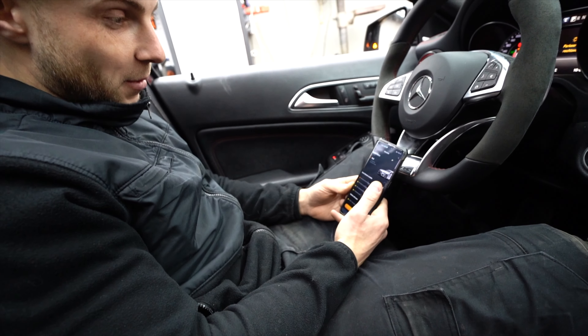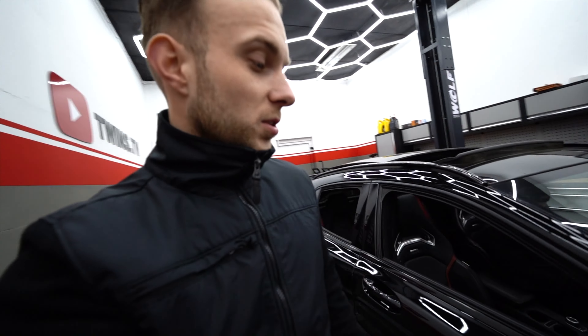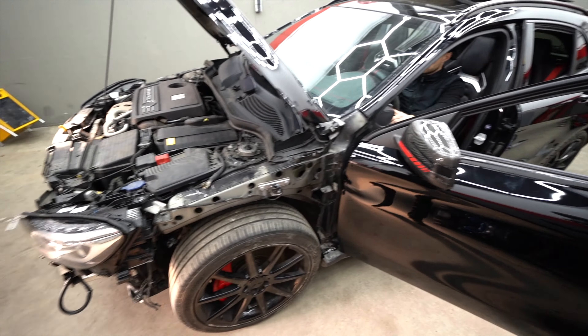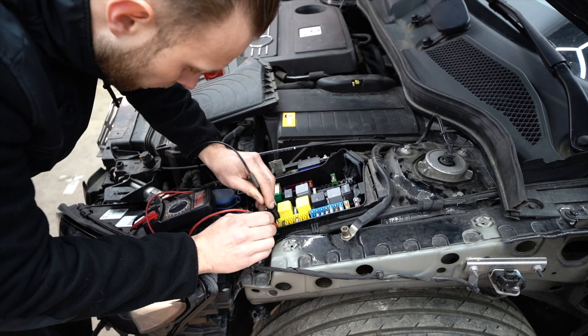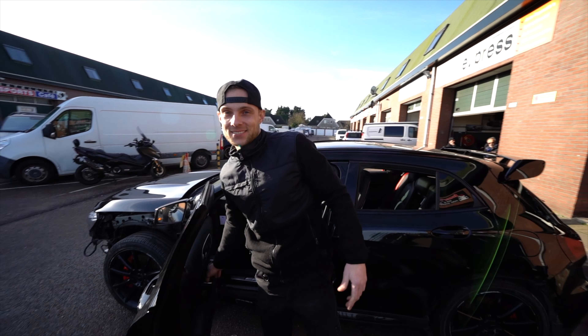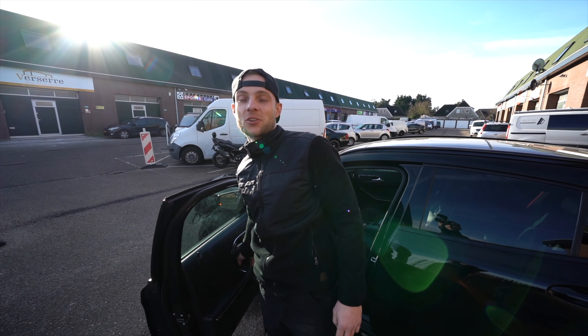After clearing, 11 errors have come back - it's no longer very bad, now it's just bad. The rear lighting actually works - brake light is working, left indicator is working, but the right indicator is not working either in the mirror. I personally think it has something to do with a collision alert in the display because we also have no power steering. We checked the fuses - they were fine. Unfortunately I didn't find anything there that could have triggered the collision alert. The wheel arches on the bottom look like we've been through the Sahara. We're going to jack up the car and give it a good scrub from the underside.